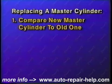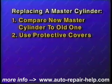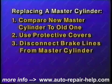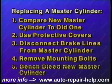First, compare the new master cylinder to the old one. Use protective covers to keep brake fluid from getting on the paint. Disconnect the brake lines from the master cylinder. Remove the master cylinder mounting bolt and the master cylinder. Bench bleed the new master cylinder.